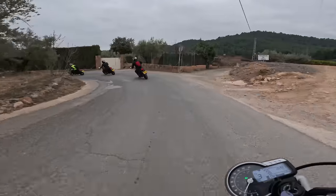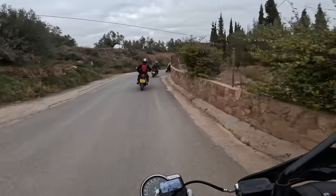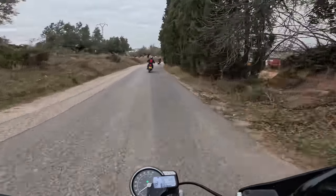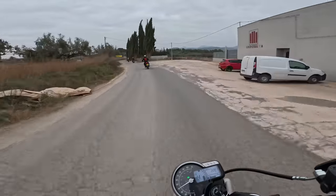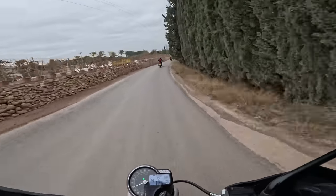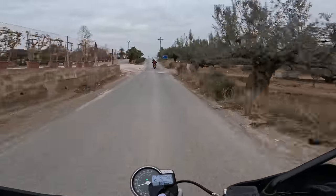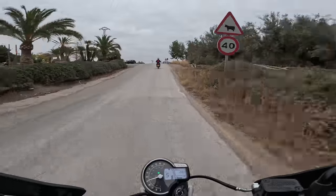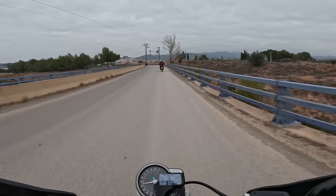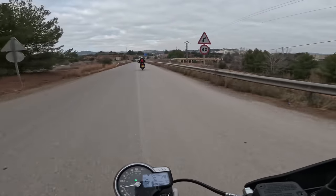Something I'll note — I'm not feeling it on every corner, but it's happened to me a couple of times: when you go to really tip it in and get a little more aggressive lean angle on the front end, there's this weird little step-off feeling where you start to roll on the tire and it kind of falls and you almost have to catch it again. It's caught me off guard and spooked me a couple times — the front felt like it was pushing. We'll see if that persists.